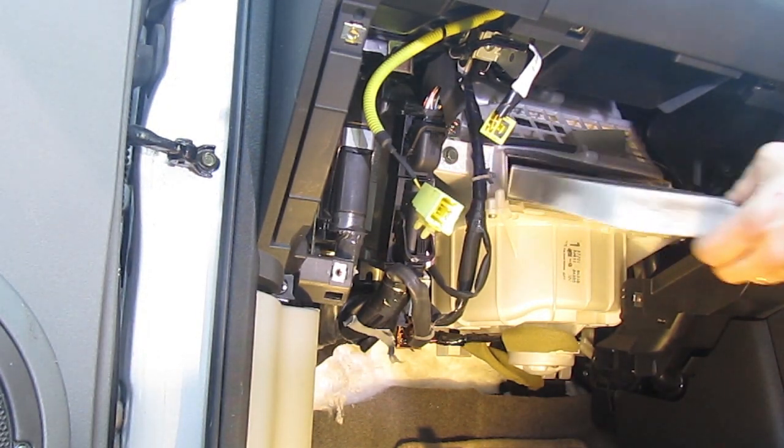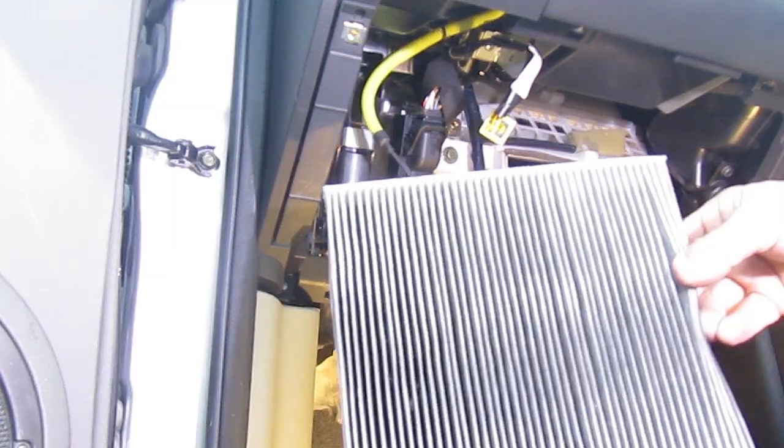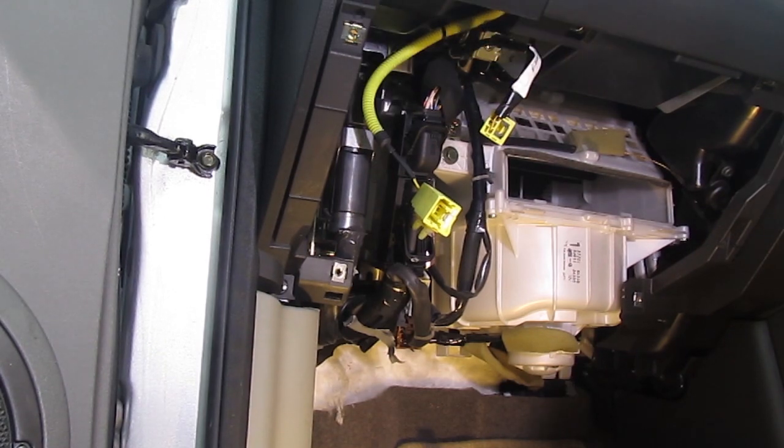If in doubt, the air always flows through the filter before it goes to the fan, so on that one the top side is the dirty side. I believe that other versions of the X-Trail are very similar — it's just that the filter is mounted vertically, so your pollen filter will actually go vertically rather than horizontally as it is here.